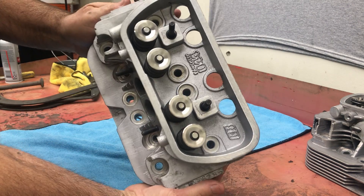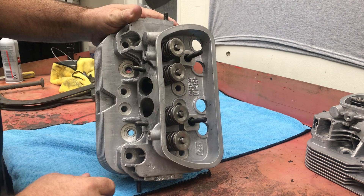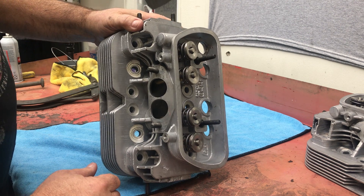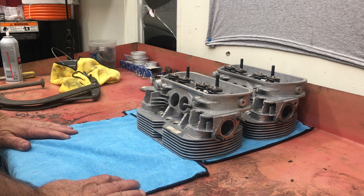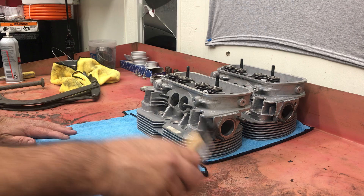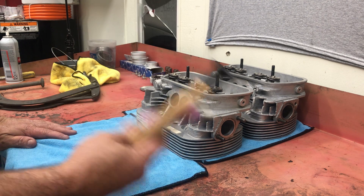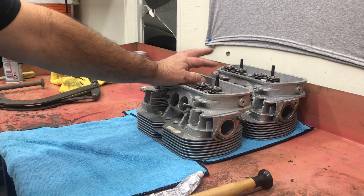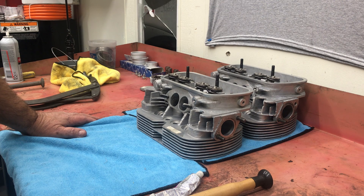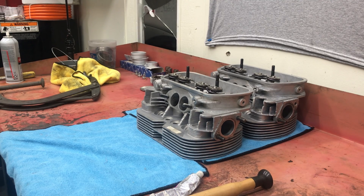Before I bolt these on the car, I'll take a rubber hammer and tap each spring and make sure everything is seated and all the locks are where they want to be. Other than that, these are ready to go. That's how I assemble the cylinder heads - motor oil. I hope that helped some of you guys out there. Also very important is lapping the valves in. If you don't have access to a valve job, this is your next best friend. You want to make sure your motor is sealed up - the cylinder heads play a huge part in the way the motor performs. This is my favorite part of the engine because that's where all the power is at - it all starts right here. Thanks for watching, thanks for subscribing, and we'll see you on the next one.